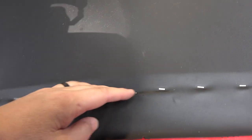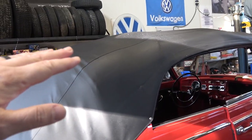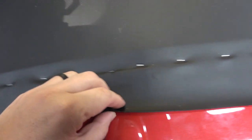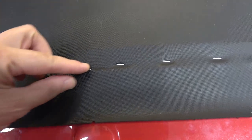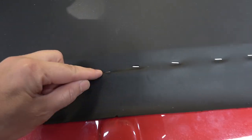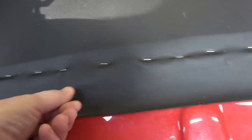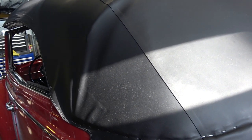If you pull too much and can't close the top, you've got to take the staples out — and then the holes that were once here are now up here because you had to maneuver it. I like the top to be almost closed on the earlier beetles before you start pulling back here. The wrinkles are almost coming out, then you start pulling back. It's still going to be tight. You're going to staple literally right above the body line into the wood. You don't want to go much higher than that because either the chrome trim piece or the vinyl bead from the kit will need to cover it. Staple all along the body line, pulling tight every inch or two, moving wrinkles out of the way.